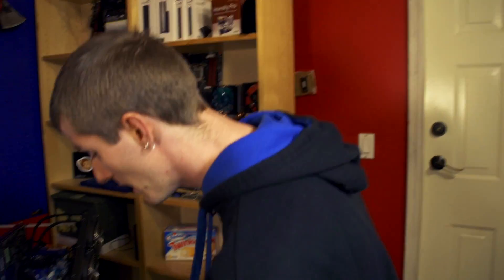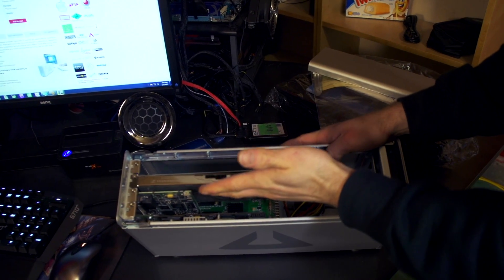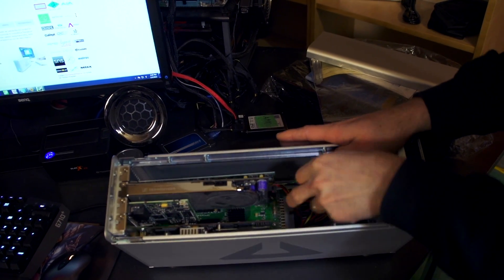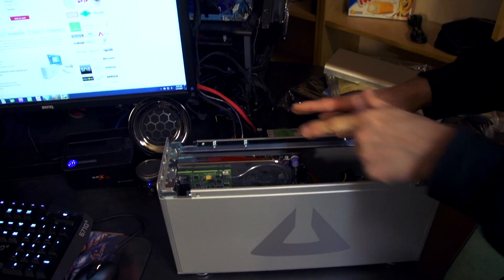Power is provided by two Molex connectors, which you can adapt to PCI Express. On a Mac it apparently runs completely driverless — you just throw the Quadro 6000 in, plug in the power via a PCIe adapter, and you're good to go with that 250 watt supply. The RAID card didn't get detected, and the Xonar Xense works but the ASUS control panel wouldn't install. So I've encountered everything from cards that don't get detected at all, to cards that detect and work perfectly like the Blackmagic, to cards that work but not quite completely.